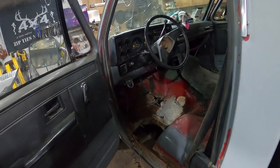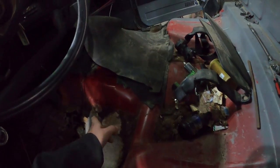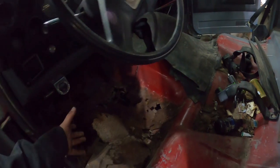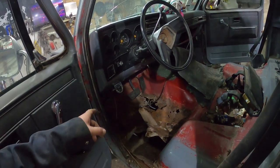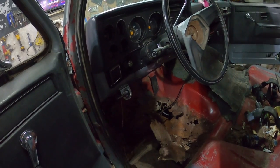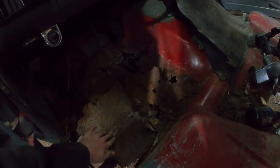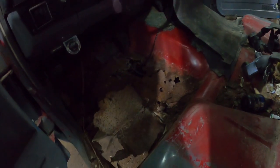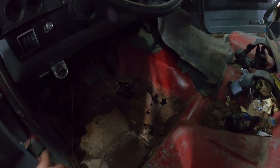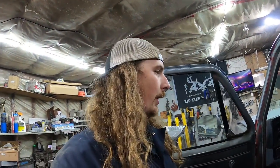But really that's about it. The cab support's decent, up here is really good shape. The tunnel's in good shape - just kind of where the boots were over the years. So I'm going to get to cutting that out as nice as I can without tearing the wiring and stuff. I'm thinking I'll just cut it all out, overlap it by an inch, weld it in, seam seal top and bottom, and it'll be fine for my lifetime with this truck.